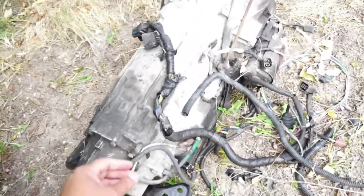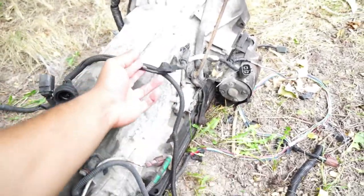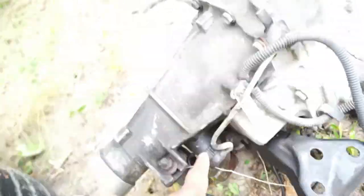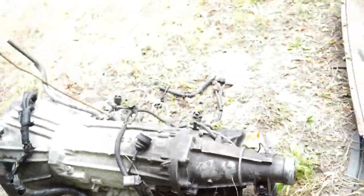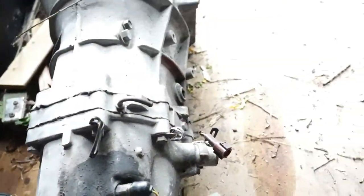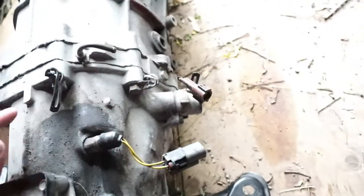Now let's look at the wiring harness on the automatic transmission. The wiring harness is huge — it has a lot going on, with the starter connecting to all different sections of the wiring. Right here you have the speed sensor, and here you have the RPM sensor. All you have to do is take the RPM sensor off the automatic harness, because you don't necessarily need the speed sensor. From my research, as long as you have the RPM sensor connected, you don't need the speedo sensor — it will calculate itself. On the manual transmission, one sensor handles both RPM and speedo, so you don't need all of that.